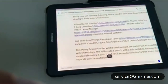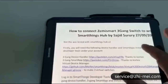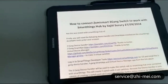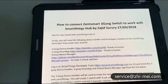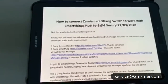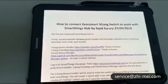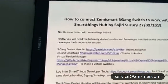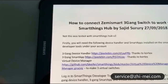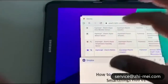I've made notes in a script which I'll show you. First of all, we need to download the device handler and install it in the SmartThings developer tool online. You have to go into your account under the SmartThings developer tool, select your hub, and then install these. First, download the 3-gang device handler, 3-gang smart app, and virtual device manager.